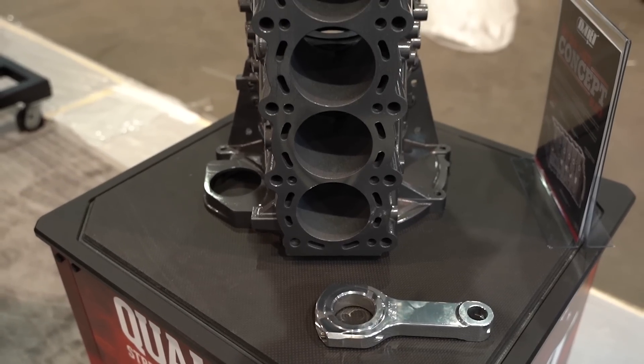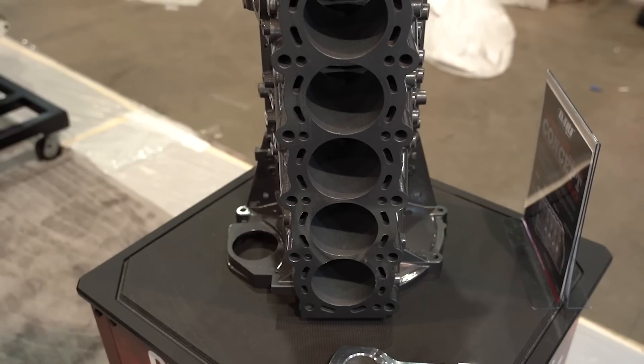Safe to assume you're also using a billet cap as part of this? Yes. In terms of deck surface and bore thickness — we've seen a lot of cracking through the deck, usually from over-torquing the heads. To combat that, we added deck thickness. Factory blocks are around 200 to 300 thousandths depending on the casting and core shift, where ours is set at 750 thousandths. That allows us to have a lower clamping force on the sleeve and keep that deck surface as true and flat as possible, which helps with head sealing at higher boost pressures.